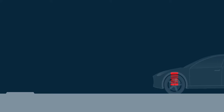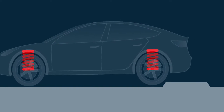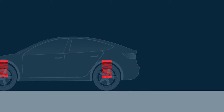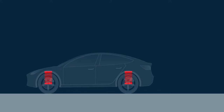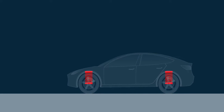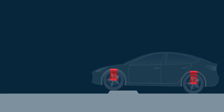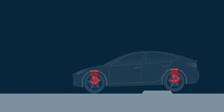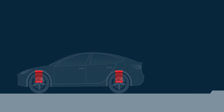Springs in a suspension system absorb the bump and again regain their length back to maintain the wheel contact with the road and also to maintain the height of the vehicle. But using springs in suspension is not that simple — it comes with its own drawbacks. One of the main drawbacks is when the spring is uncompressed suddenly, it vibrates back and forth. So if just springs are used in a suspension, that won't give a good ride; rather it will vibrate you inside.